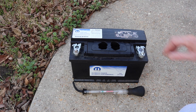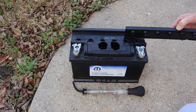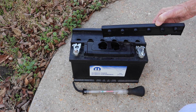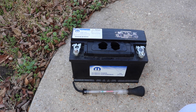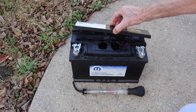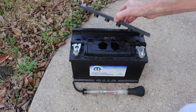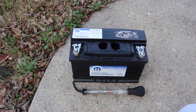I think the reason it might have blown up — it's hard to tell — but I've got several of these and only two of them have a fluid level above the plates. I suspect the reason it failed in the truck was the electrolyte got down below the plates. When that happens, you can kiss that battery goodbye. That might have happened over the course of three years or whatever, which is when they failed — just under and just over three years. It also speaks to the need to be careful when you're charging these things, because you really never know what the hell is going to happen.